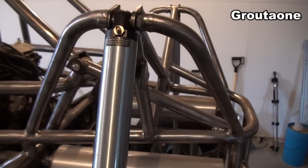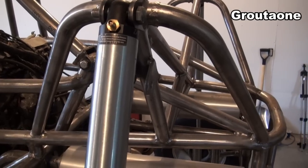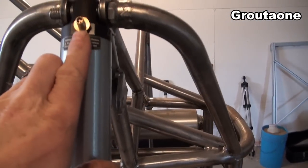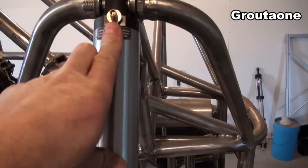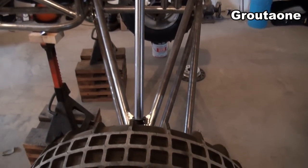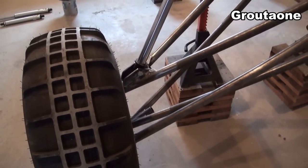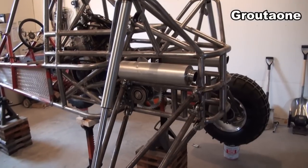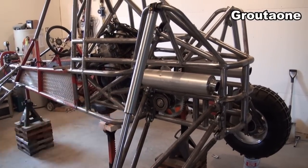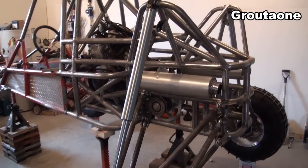In the back I'm going to be using these 16-inch Fox air shocks — they're two-inch and they don't have springs in them, it's just nitrogen pressure. I'll probably run these in the 400 range; you can put up to 500 pounds in them. These shocks are mounted close to where the wheel is, so the leverage factor is not going to be as extreme as the front. The more you leverage these shocks, the more load there is on the hydraulics and the damping gets diminished.